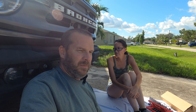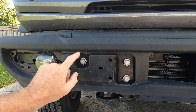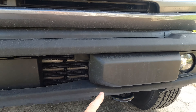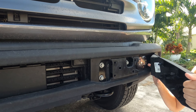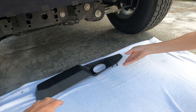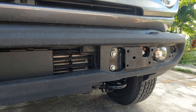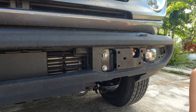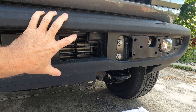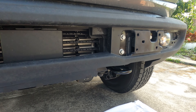So the first thing's first — we had to take off the skid plate or splash guard because we need to access stuff underneath the bumper. The modular bumper has a panel here with three or four screws covering three bolts. On this side, it's just a simple pull — Jill will pull it off for us. There are six clips and two alignment pins that let you access the bolts to actually remove the bumper. There are other things behind this we need to look at once the bumper is off, since the instructions describe a completely different bumper than what we have.